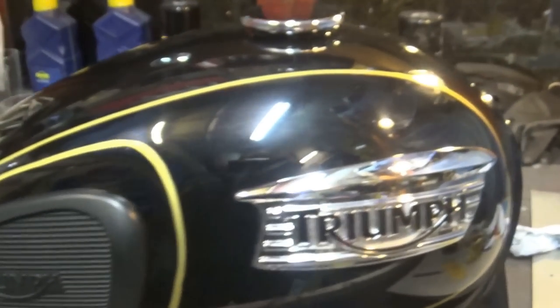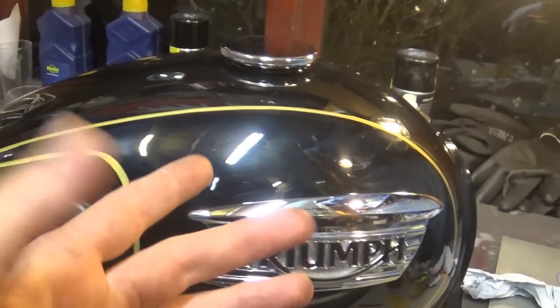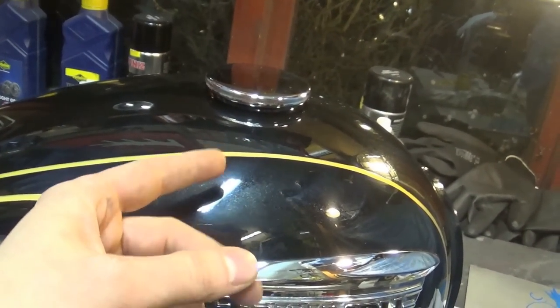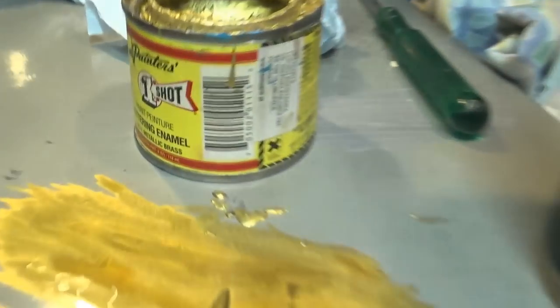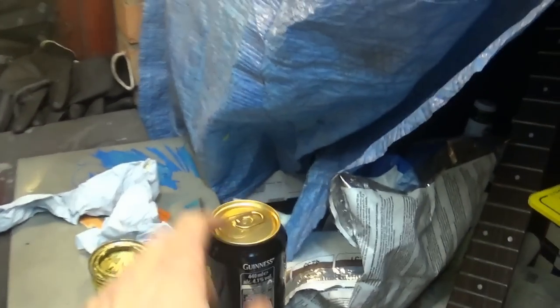The paint hardener helps a little bit, but you sometimes need to go over it again, so be prepared, especially with the metallic colors. When you're painting on a completely contrasting surface, you may not get the full coverage the first pass through. The one-shot paints are usually really good for coverage, but the metallic colors can sometimes be a little bit tricky.